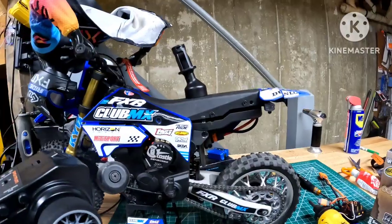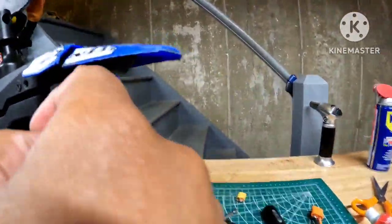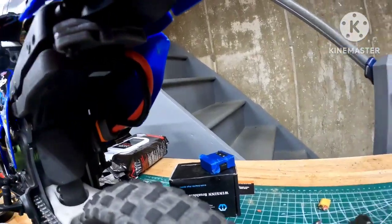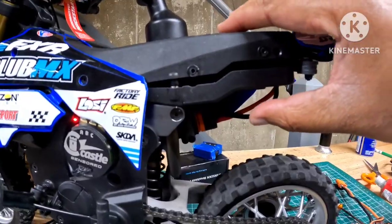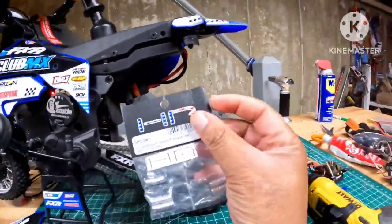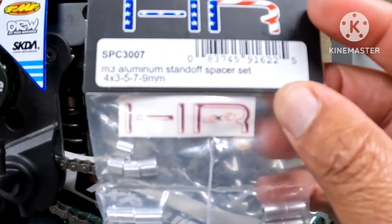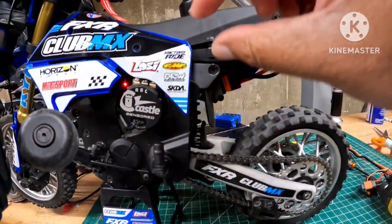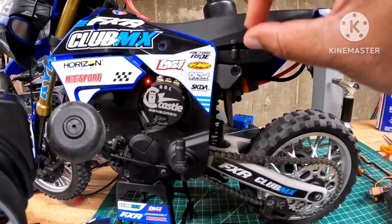I'm going to go through and tell you about some updates that we've done and talk about what's in the car now. Shout out to XOKJRC — he was talking about a 3D printed latch from Fine Designs, so we got one of those in and put that in. It's perfect. The next thing we did is we had to make room in the battery box seat to accommodate a thicker lipo. We used spacers from Hot Racing, part number SPC 3007 — their N3 aluminum standoff spacer set. You get 3mm, 5mm, 7mm, and 9mm heights. Right now I'm using the 3mm height to keep the seat up. The seat is held with four screws. We unscrewed all four, put the spacer in between the two halves of the car with a little longer screws, and screwed it up.